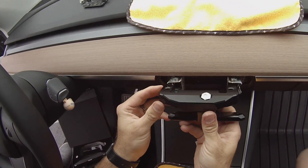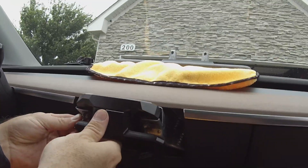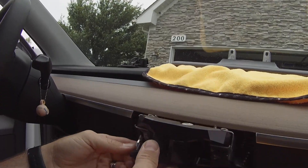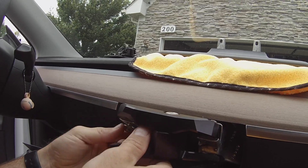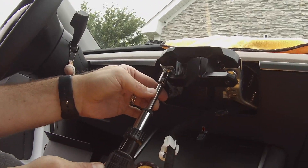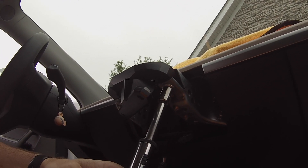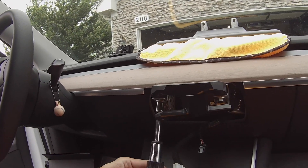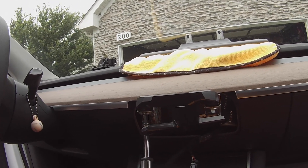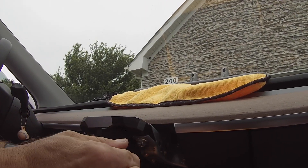You've made the turn — now you're installing. Get your bracket and set it right inside the two holders. Take the two bolts that originally held the monitor and screw those through the holes and through the new bracket. Use the 10 millimeter socket and tighten them down, alternating sides. Give it a test turn to make sure everything is super tight before moving on.